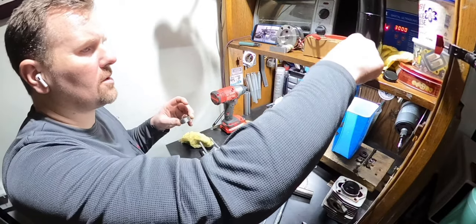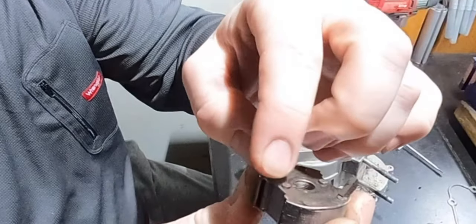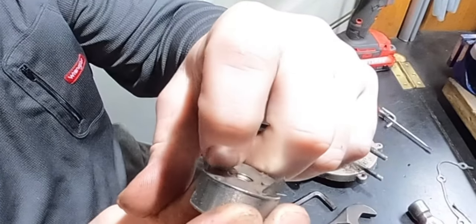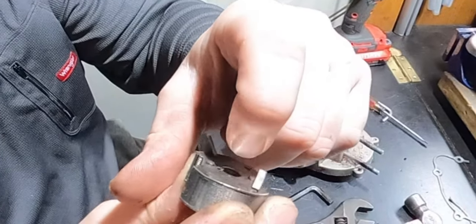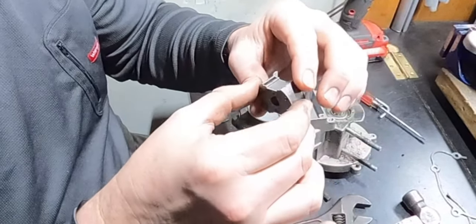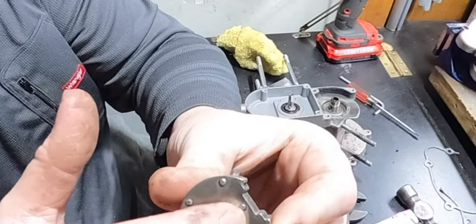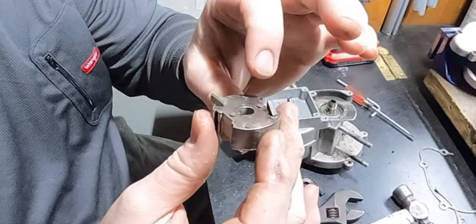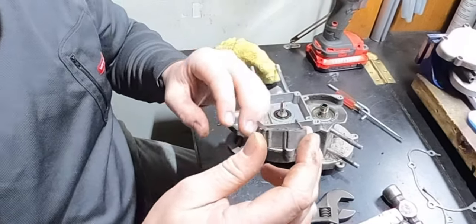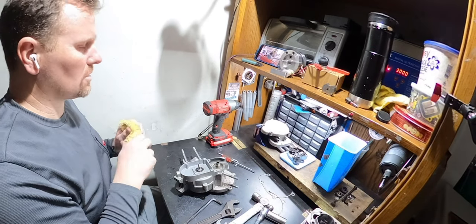Another thing that I found and noticed is the magnet. Don't mind the keyways, I always put them on a magnet not to lose them. But you see how high these two rivets are compared to the rest of them. These were never punched through properly. So there's nothing wrong with the magnet outside of that. Now you can see in the front, they don't come through. So I'm gonna have to either put another magnet on here or just beat these through and re-cinch it. They basically just gotta be pounded flat so that they're good.